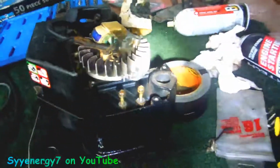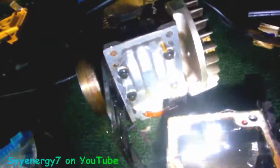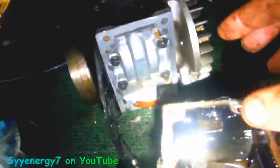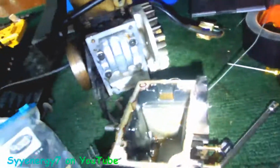So put the 2 bolts back in there. Hopefully I don't have to take this clutch off. Well, you don't have to take off the clutch. It just slips off. I was thinking there's no stud in here or anything. But this all has to be super clean. Actually, what I'm going to do is clean the hell out of this saw really good in here, because this has to have RTV on there, like the gray stuff I used on my differential cover, real clean.